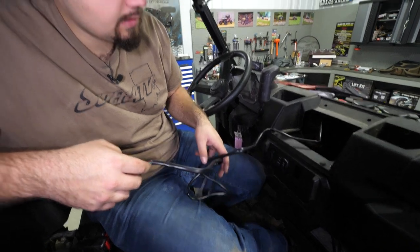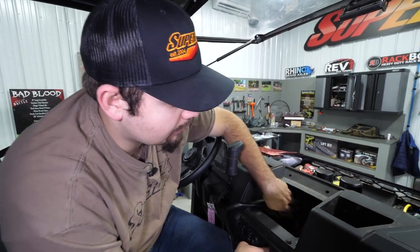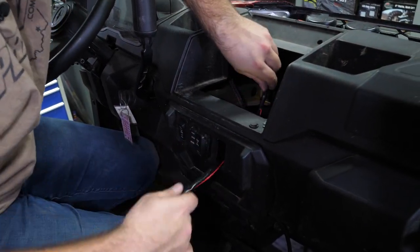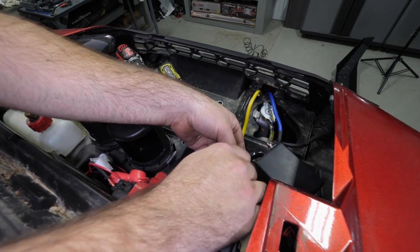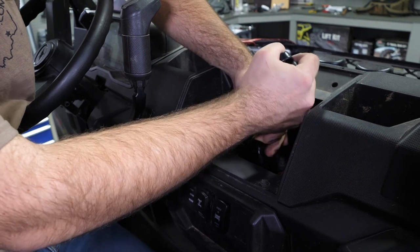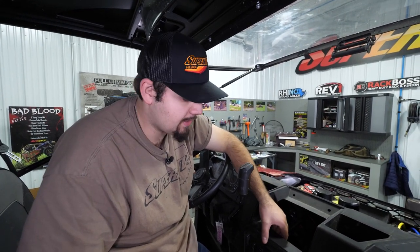I like to see how long my wiring's going to be and trim it down or leave it as-is. We're going to route all of our wiring back through this hole. The reason I showed the grommet way first is because if you're using the other rocker switch, you're not going to route everything through a dash-mounted rocker switch — you'd run it out this way. So if you're running the rocker switch, feed it right through here, get a good bit of excess through, back through the grommet, and make our connection. You can pull your wiring through and zip tie it together, just kind of loosely put it together, wrap a zip tie around it, and tuck it up here — that way it's nice and clean and out of the way.